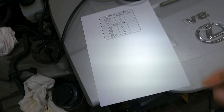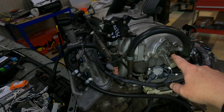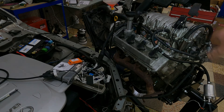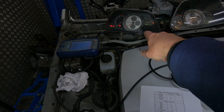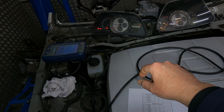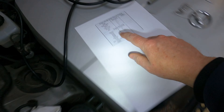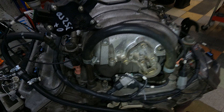So what we need to do now is get it up and running. We're going to check the starter function by starting it, check the tacho is working, check that the ACIS valve has closed, press the accelerator pedal to make sure that's working, run around and disconnect all the injectors one by one so you can see they're all working, then come back and do the test for the VVTi solenoids and go through the codes. You'll also see when we walk past that the lights have gone off and the check engine light has gone off for no active codes. Key in the ignition - three, two, one. All right - number one, we're happy with that. All the lights have gone off, we've got tacho, we've got no check engine light, and we can see that ACIS valve has now gone down.